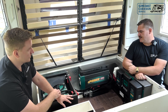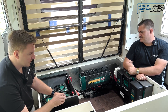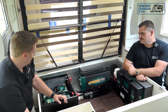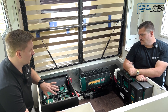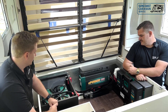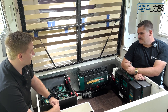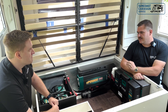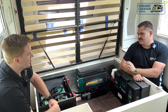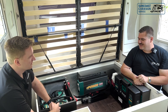Should that gas actually escape out of the battery itself, it's not going to escape outside of the box into what is classed as our habitable space. Because there is obviously still ventilation within this bed space, everything is going to go straight through that one-way valve to outside of the van. So that's what the standard's asking for regarding battery fitment — you guys have smashed it, it's awesome. One of the other things they are really specific on in the new standards is the solar, so we might pop up and have a look at the solar side.